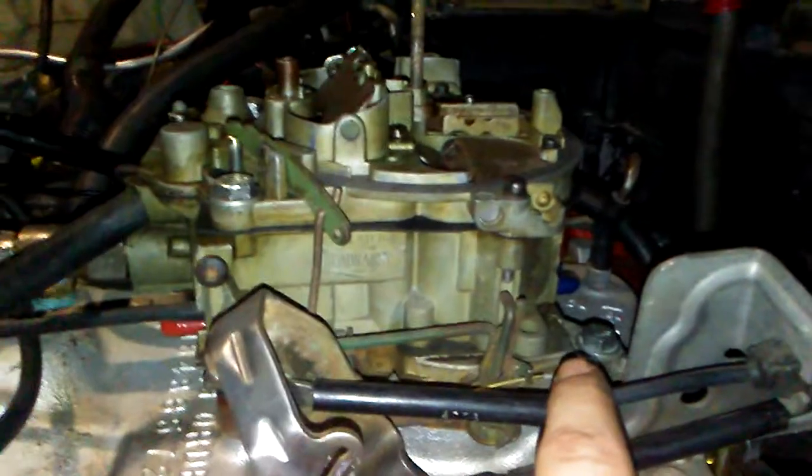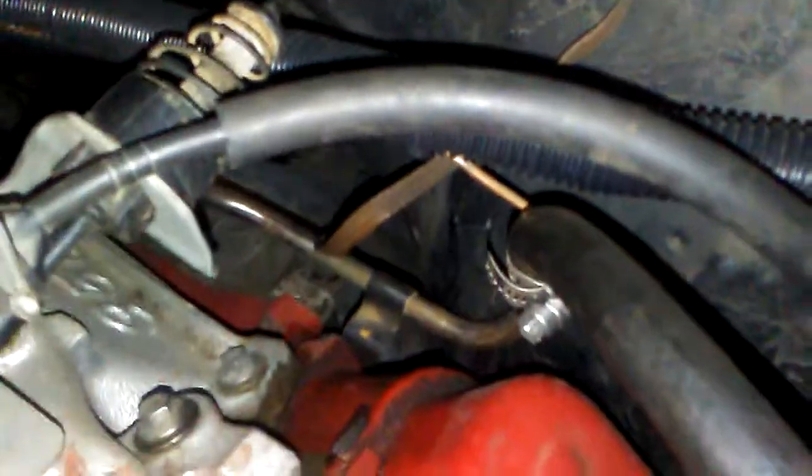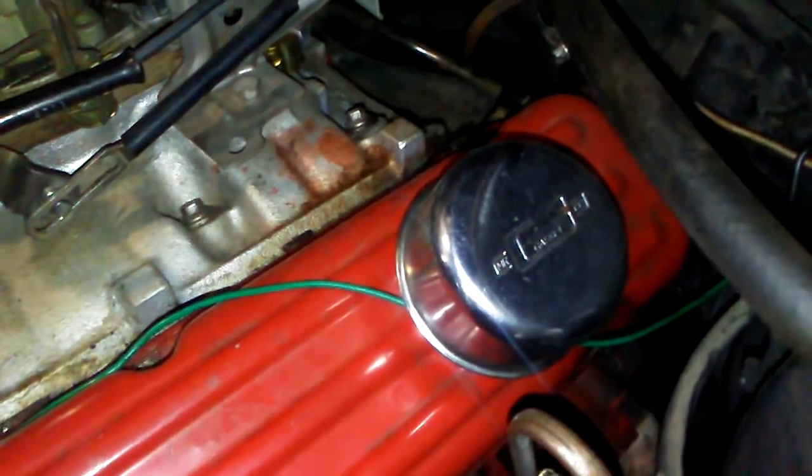I finally got one of these damn brackets, which are specific to cars with Buick 350s and Turbo 350s and Quadrajets from 1975 to 1977, I think, before the A body got downsized. Oh, fireworks. And anything else? I got this cool little factory brass fitting and steel brake line assembly, so it's not just all one piece of rubber hose, so it'll collapse less on full throttle acceleration and rapid deceleration.